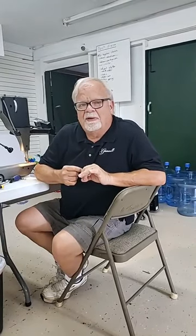Changing needle bar bushings is not something that's common. Like I said, this machine here is 22 years old, I believe. We're looking at the serial number. It's an old machine, with the original needle bar and original bushings. This one looks like it's going to need a needle bar bushing. Like I said, it might even be just the needle bar is worn. I'm going to try that first, and see if that takes care of that play. But that's another example of things to check, because if I loosen my hook because it looks like I've got a gap, and then I try to retime it, and the whole time the problem was the needle bar bushing, or the needle moving away from the hook because of the bushing, well, I've just added more work to the whole process.